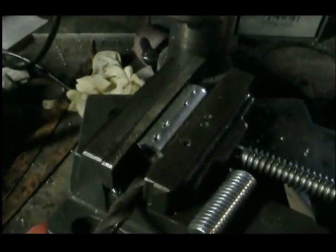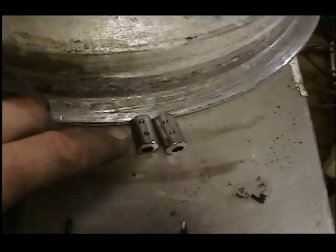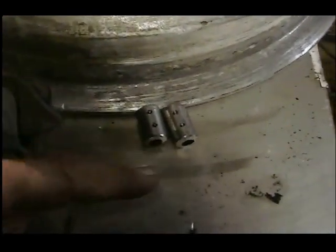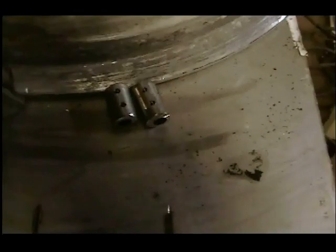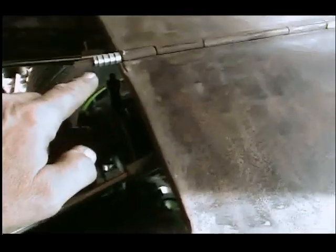Okay, back to work. Okay, I got two 6/32 holes drilled and tapped each side, cut the pieces in half. Now I'm going to see if I can position them on the radiator support rods and see what I can come up with for the rest of the bracketry. Cool. Okay, I got the collars here. Collars are on. This piece is going to be pretty much there.